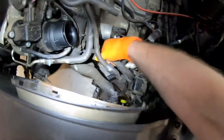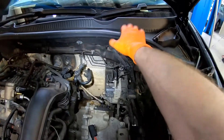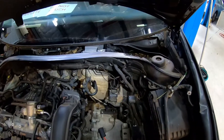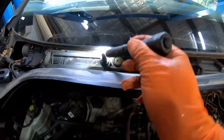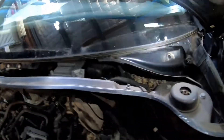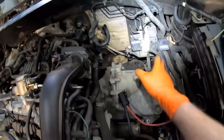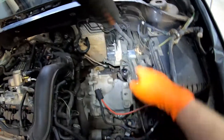We've just got to chase the wiring harness for the engine now — I think it's going to be too difficult to get it off the engine side, so we might have to take the shroud off, the wipers, and the scuttle panel off just to get to the ECU which tucks underneath the bottom of the glass. We've removed the scuttle panel, removed the wipers — just two 13mm nuts hold them on and then we can get them off the taper by rocking back and forwards. We've pulled the scuttle panel off, which you just lift at the front once the rubber is popped off. We can now see our engine ECU and wiring plugs here, so we're going to trace them through the bulkhead and disconnect all the way along here and pull it out.